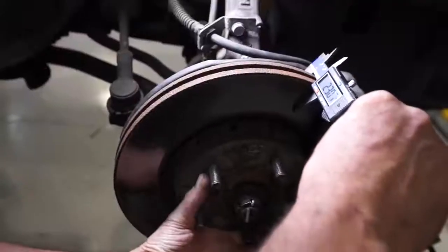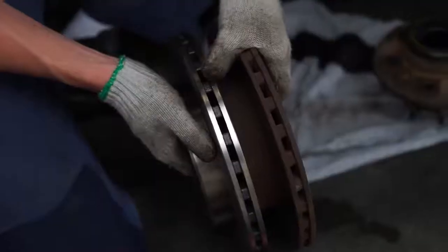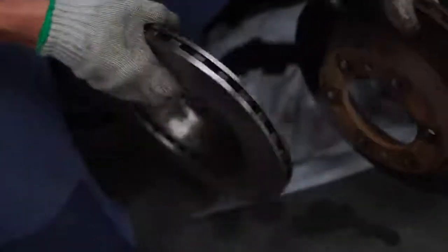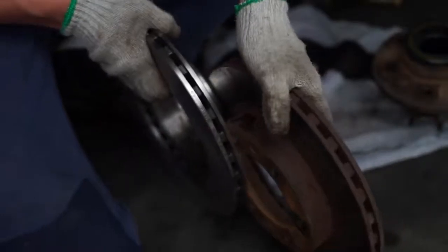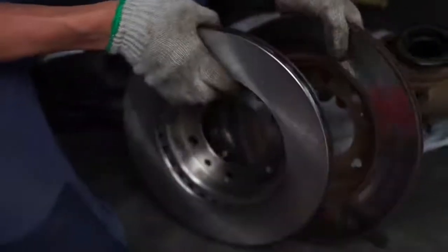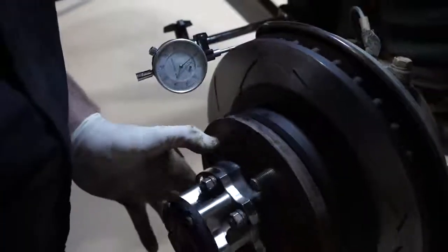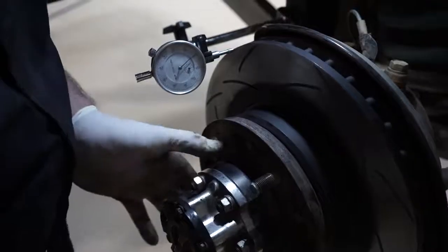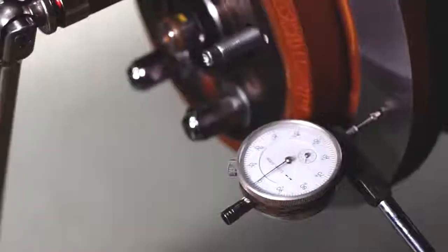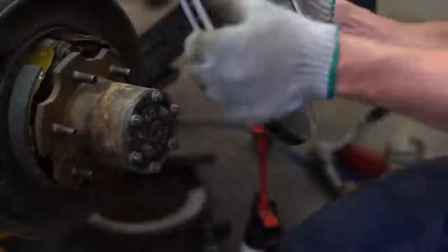This thickness variation will not occur if there is zero run-out on the rotor. However, vehicle design tolerance variations and general wear and tear may mean that a zero run-out tolerance is unachievable. On-vehicle measurement of rotor run-out using an accurate dial indicator, coupled with a good quality torque wrench to tighten the wheel nuts, will minimise DTV. Less run-out leads to lower DTV generation.